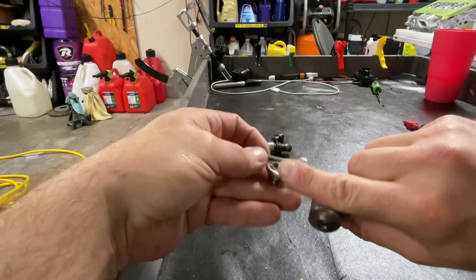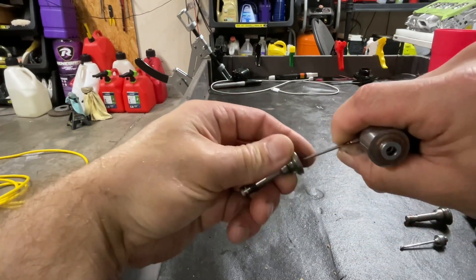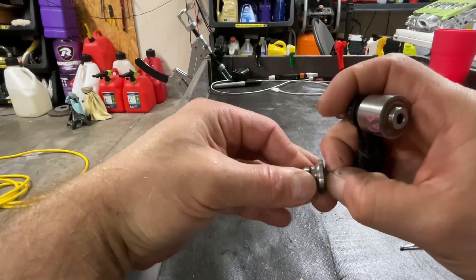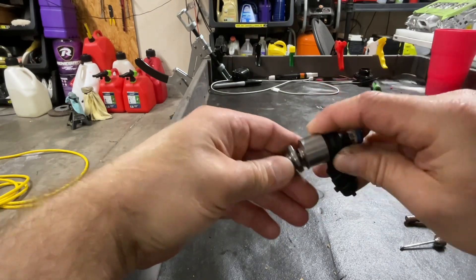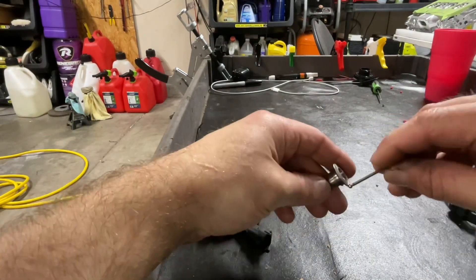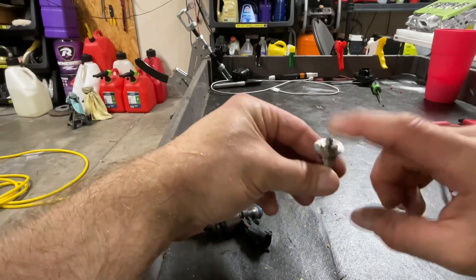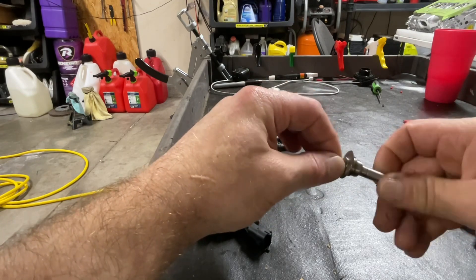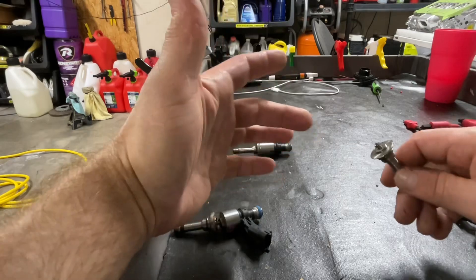When this is actually operating and this lifts, this piston comes out — it's directly in the middle of the magnetic field. What does that do? That essentially allows this to self-locate and free-flow in the middle, so that becomes a frictionless movement.